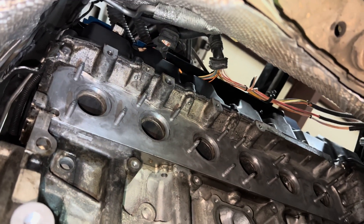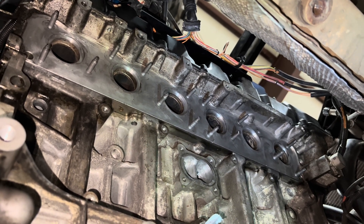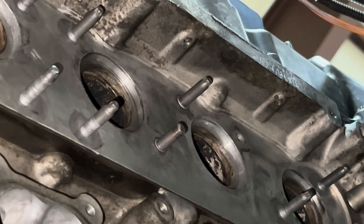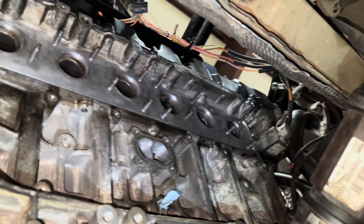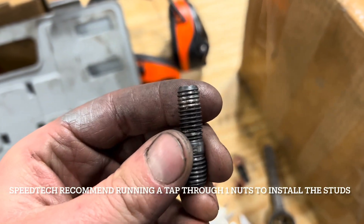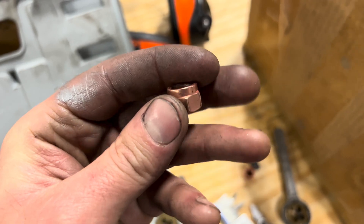Another thing I did — I removed all the studs and then put them back in and unthreaded them again to make sure all the holes were clean without any debris. I cleaned them up with carb cleaner then aired them out. You have to remove one of the studs because there's not room for that one, and you have to grind 5.5 millimeters off the other stud so you can put a nut on that one. All the other studs go back in like normal, and I put anti-seize on all the studs hoping they won't get stuck again — I had two that got stuck and one was very difficult to remove. The nuts are made to lock, so they just kind of destroyed the studs when I was trying to use the nuts to install them. I think that was a real poor decision for them to make the kit that way.